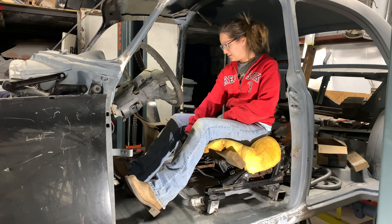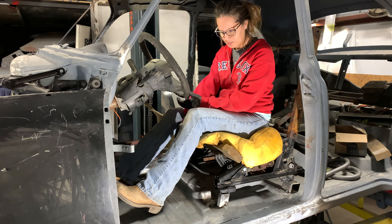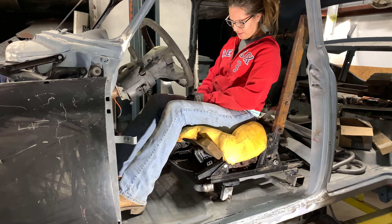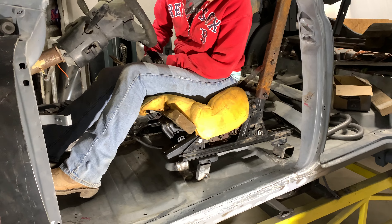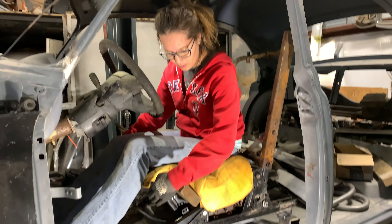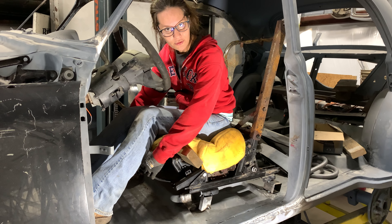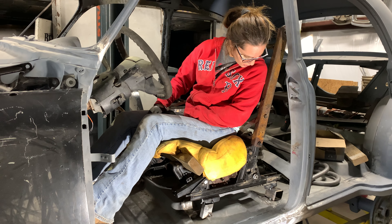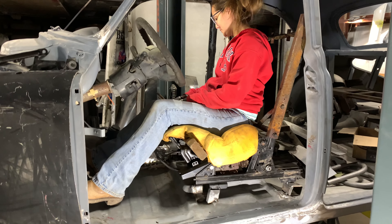Go ahead Bridget, move your seat forward and back — it's all the way back, locked in. Now tell them about these little brackets we just welded in. Those are just placeholders — not permanent — to keep the seat level and keep each slider level with each other, because you have to make sure the sliders are level with each other and level with your vehicle as well. Having Bridget actually sitting in the seat today was very instrumental.